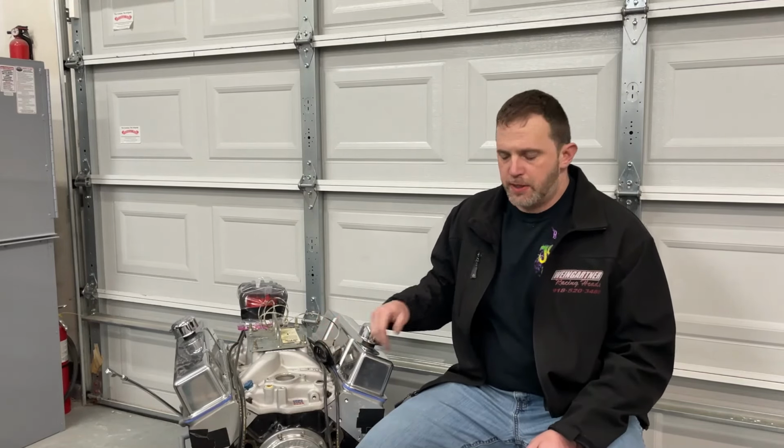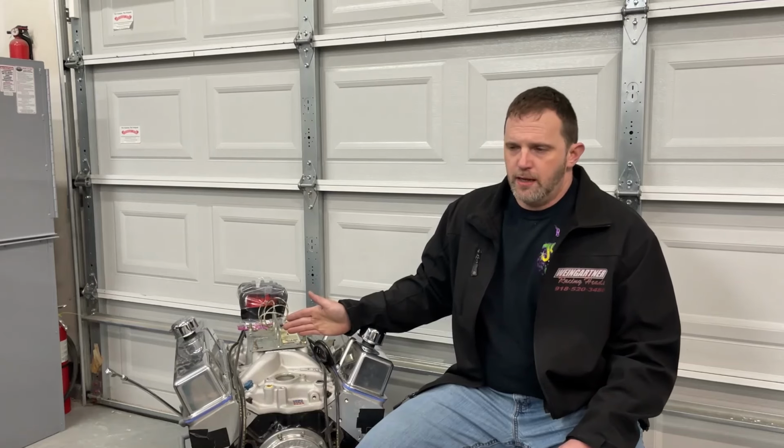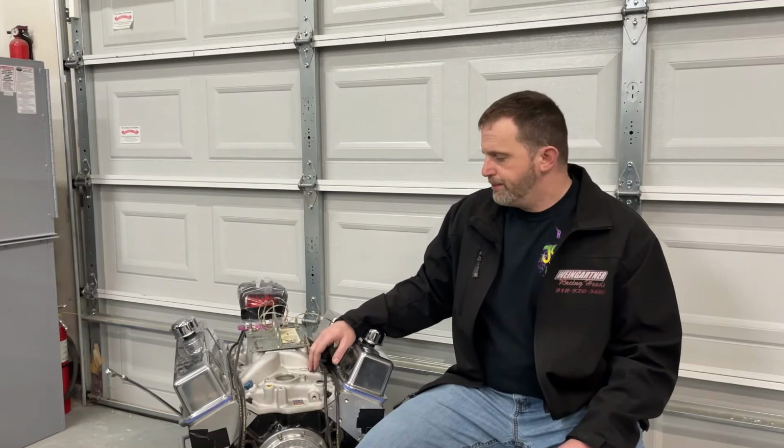And yeah, I could probably move up to 38 degrees because the quench being so high, it's probably going to make a little bit more. But I said, there's really no point. You know, 36 degrees is fine. There are no signs of spark knock or nothing, and there's just no reason for it. And there was no reason to adjust the jets on the carburetor, because after all, again, we're not using it. So the only thing I wanted to try was some spacers.